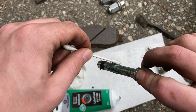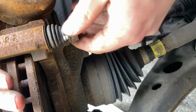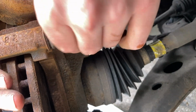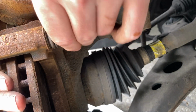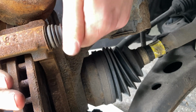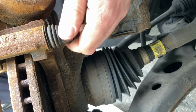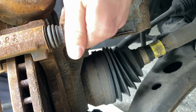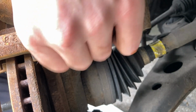And on one of them, I took out the pin once and then wiped it down again and then put more grease on and did the process all over again. Because I found when I twisted it inside of the caliper, it wasn't twisting very smoothly. So I just wanted to make sure that it was as smooth as could be. And I reapplied until there was enough that I was satisfied with it, and I moved on to the next one.